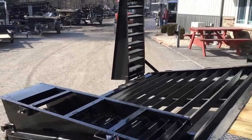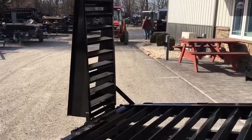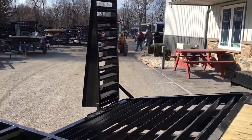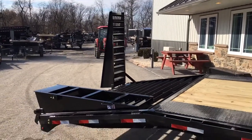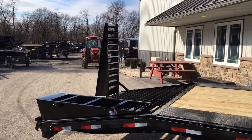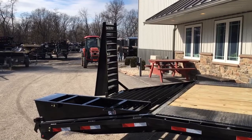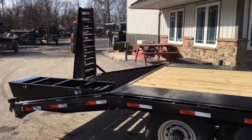On the far ramp, on most of our Lamar Deckovers, we're going to do the stand-up ramp bars, which is an available option. Many manufacturers don't offer this, but it's a fairly simple, cost-effective way that you can lengthen your trailer by about five foot without carrying around or paying for five more foot of trailer. Very handy setup — we do a lot of ours like this.